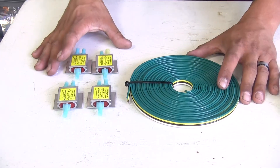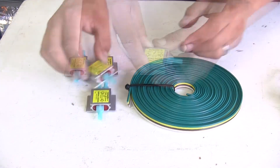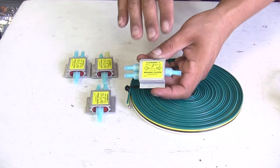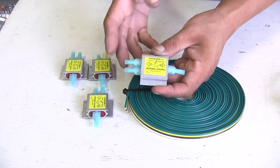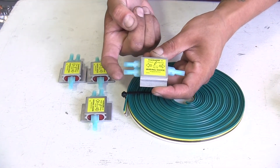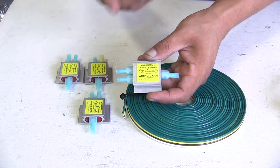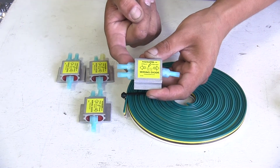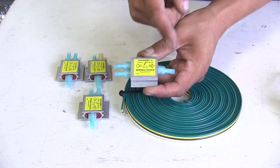If you don't want to have to drill a hole into your taillight housing, our diodes are going to be a good option. Our diodes are going to use the factory wiring on our CR-V — basically we're going to cut the taillight wire, it's going to go into our diode, and then the output is going to go to the bulb. We're also going to have another length of wire that connects up to the front and runs into our diode as well, so we'll have two inputs and one output.